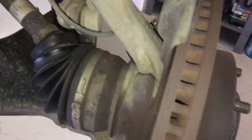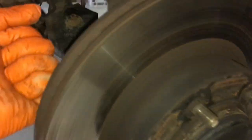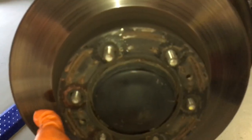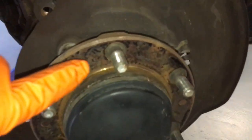Caliper is off. There's nothing else holding this on now — so it should just lift off, but it won't come off. Normally you'd get a hammer for this. Just a gentle tap and... right, and that's basically the deal. You're left with the hub behind.